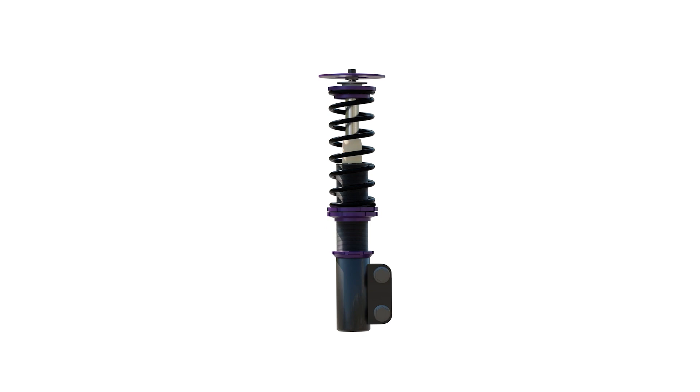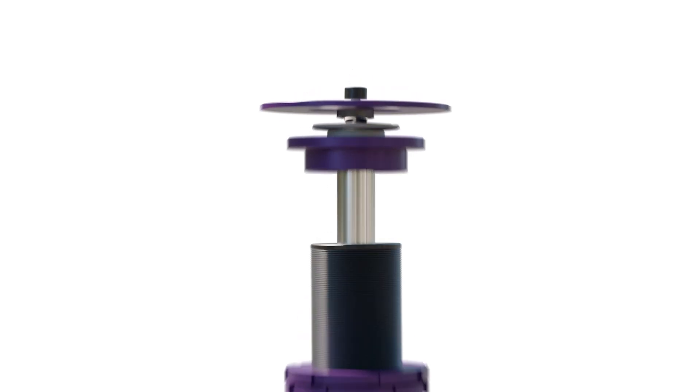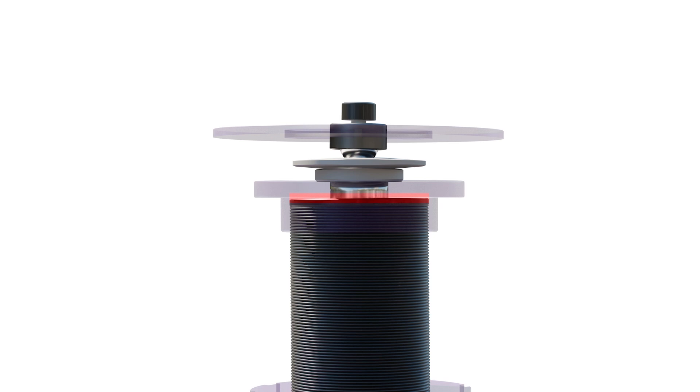In road cars, the primary purpose of a bump stop is to prevent damage to components when the suspension is fully compressed. Bump stops can be arranged in a few different ways, but the most common is when they're mounted concentrically with the damper as part of a coilover unit. Without bump stops, the suspension travel would be limited by the mechanical travel of the suspension, which would usually be metal to metal contact. The problem with this is that it puts a large shock loading through the suspension and is likely to damage part of the suspension or even the chassis itself. If full suspension compression is reached with metal to metal contact, not only are we likely to cause damage, but because the effective spring rate of that corner of the car becomes almost infinite, we're also likely to lose grip on that corner of the car, which can cause some nasty handling behaviours and even a complete loss of control.